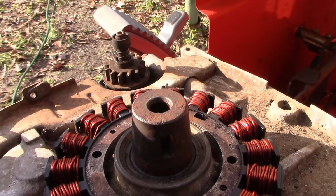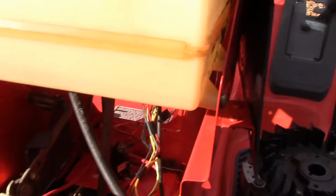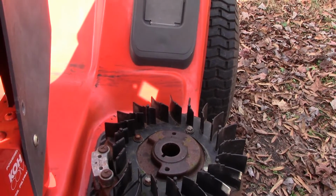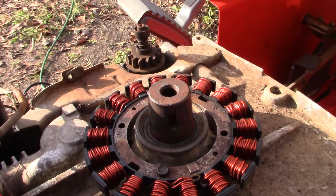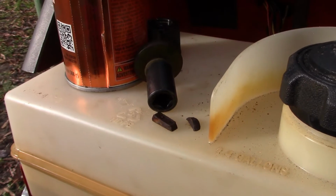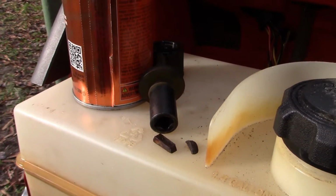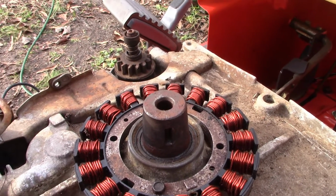It was running, but I think that might be the issue with the glowing muffler, and we had a little bit of backfiring and it wasn't entirely willing to start up easily for us. So possibly our flywheel was misaligned, as evidenced by this shorn pin. So my next step is to get one of those pins and get this flywheel back on there lined up properly.